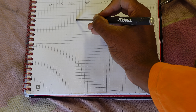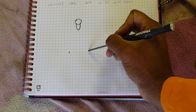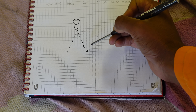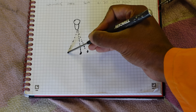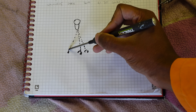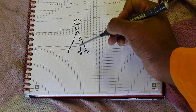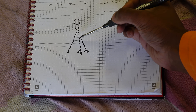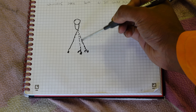To explain what happens: if we draw a tyre, and then the rim comes down, and then we have bearing spacing — that is how a well-engineered one is made, and on an inferior item that spoke might end up at an adverse angle versus the better geometry. The version with the wider bearing stance will generally be stiffer. The only way to compensate for a shallower spoke angle is by increasing the tension. If all other things are kept the same, the lateral stiffness of the wider stance setup is superior in theory and generally in practice.